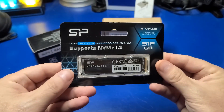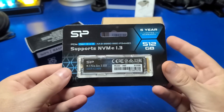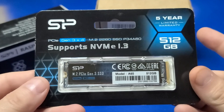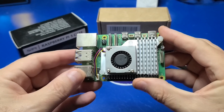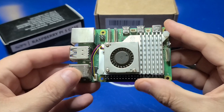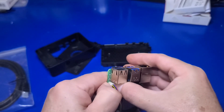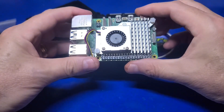We will also want to take advantage of the faster speed of the M.2 SSD, so we'll install an SP512GB NVMe drive. Both the hat and the case include the active cooler, so you'll wind up with at least one extra if you pick up both. I already have an active cooler installed on this Raspberry Pi 5. Just plug in the fan cable with the yellow wire facing outward, remove the protective backing, and push the pegs into the Pi 5.